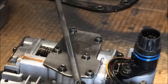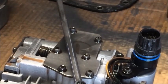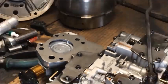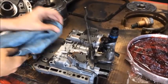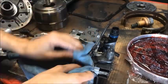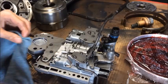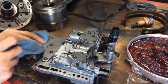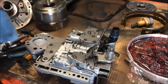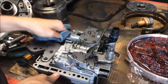So if we flip the valve body open, there may be some places we need to clean. We definitely want to clean this mating surface over here, this part of the valve body, also these plates and this part. Just want to clean everything as best we can. If you see any schmutz anywhere, go ahead and remove it. Then on the other side there are some connective parts — just basically want to clean every surface that we can.